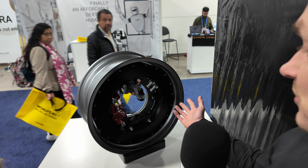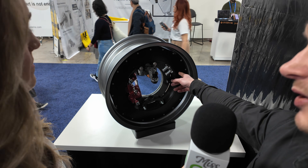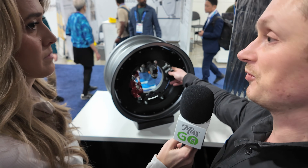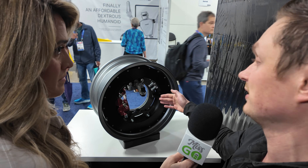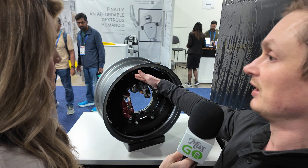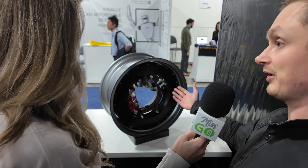The tie rod for the steering comes on this bracket over here, and it has everything it needs. This is the inlet and outlet for the oil cooling because we have direct cooling of the stator. However, for production vehicles that don't require much power, we can remove oil cooling and have only air cooling, since there is a lot of air flowing through the motor. If we run it at 20 percent of the power capacity, we don't need liquid cooling — we can have blades on the rotor to suck enough air to cool the motor. At this stage, because this is a high performance motor, we still require oil or liquid cooling for this particular model.